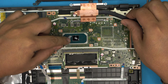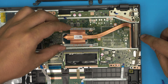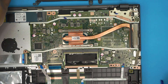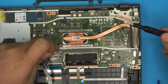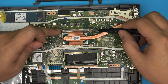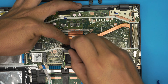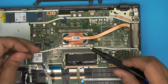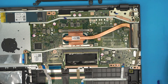Don't put too little — put a fair amount of thermal paste, but don't overdo it. Grab the heatsink, align it from one side first, and bring it straight over making sure the screw holes match. Once it's placed, do not lift it back up. Now cross-screw them — for example, go three, four, two, one. The reason for cross-screwing is so the thermal paste spreads evenly; if you tighten one side first, it pushes the paste to that side.